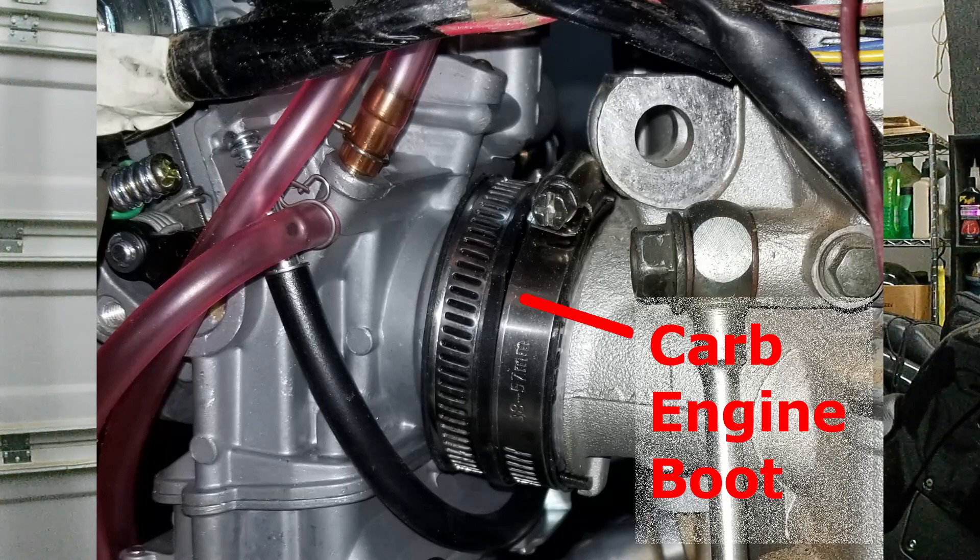Air — there's such a thing as too much and too little air, and this is particularly true with carburetors. A carburetor works by the Venturi effect, which creates a suction that pulls the gas through. That suction cannot happen if you don't have a good seal on the carburetor to the engine. That boot between the engine and the carb must be good. If it's cracked, the engine won't run, or even if it runs, it won't run well — you'll have trouble especially with idling. Air leaks are one of your biggest issues, aside from getting fuel.